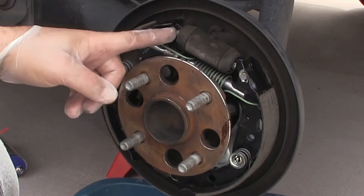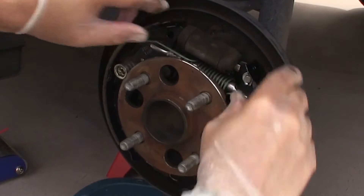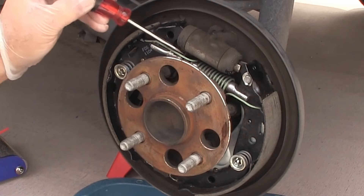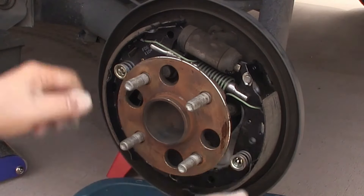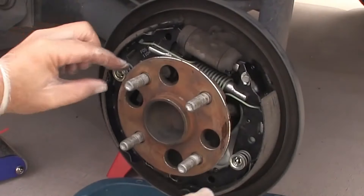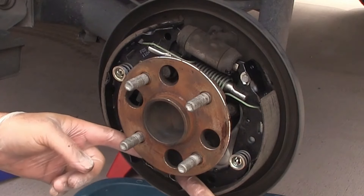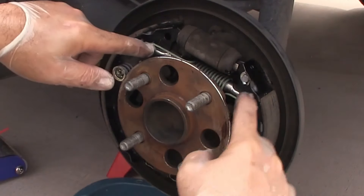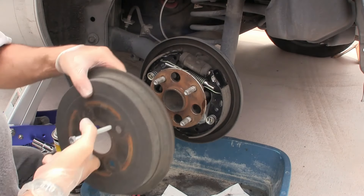Things to inspect here: this is where it belongs and it's captive. Notches in front, the notch is in back. The adjuster is right up against the teeth and then the spring down here is behind this little metal plate and connected. Once it's all in there, it really won't go anywhere. You can slide it around but it doesn't just fall apart. Give it a good shake and wiggle and that should all be locked in tight. Down here it's also inside these two tabs. In the tabs, behind the spring — these guys are in properly. It should be flush and flush basically.